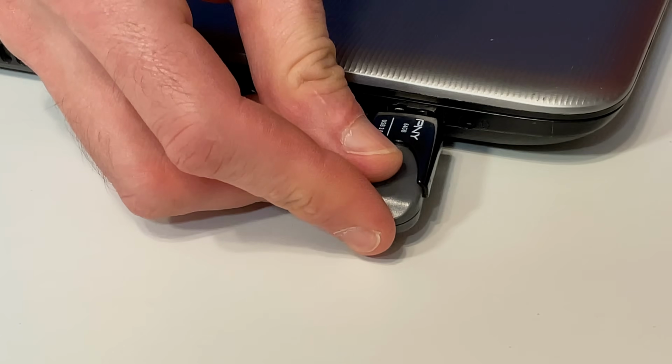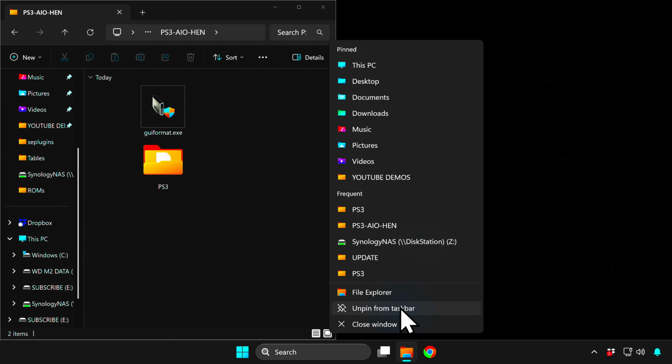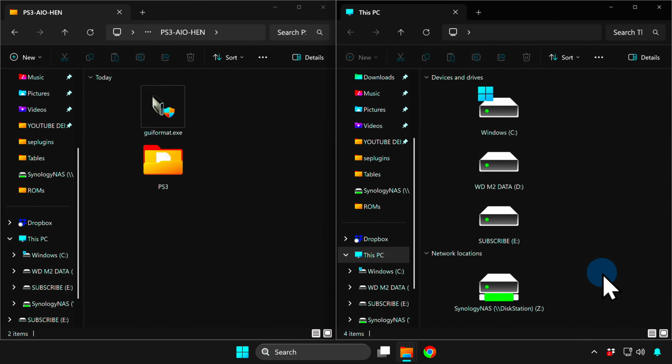Insert a USB-A drive into an open USB port on your computer. If you have Windows set to open File Explorer when you insert a USB device, great. If you don't, open up a new instance of File Explorer and go to This PC. I'll take the File Explorer window with This PC and drag it over to the right side to snap it into place. You'll need to identify the drive letter assigned to your USB drive by Windows. In this case, it's drive letter E and it's named Subscribe